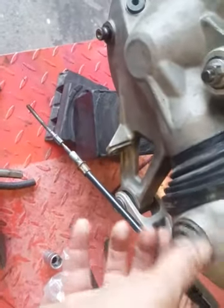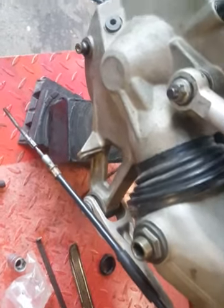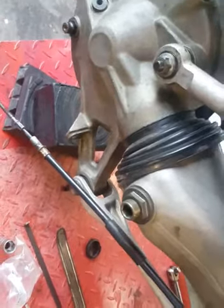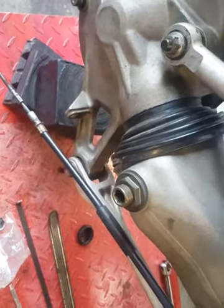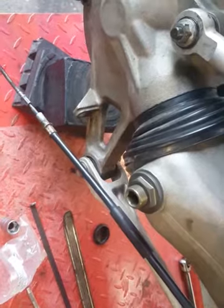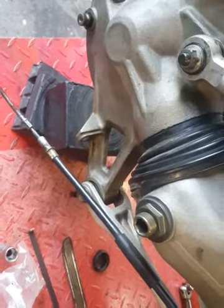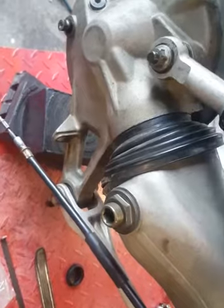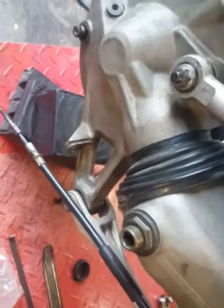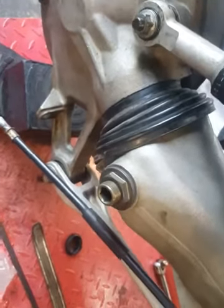Now the trick is this hex here and the pivot I showed you on the other end of it in the video the other day. It goes home to the bottom of a blind bush, which is now made out of steel and which I've greased very finely with moly grease, cleaned everything spotlessly and cleaned the threads down so I can Loctite them when I'm finished. Squeeze the grease out of the bush by pushing the pin home and allowing it to come up through the grease nipple hole. What I want these to do is go home and seat and then just nip. So you want the chamfered rounded ends of the pins just barely kissing the end of the hole in the bush. That will stop any lateral movement but still allow it to rotate on the pin, and that will give you the kind of life that will make these actually worth buying.